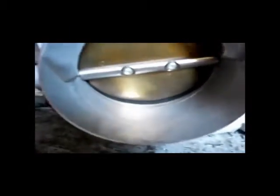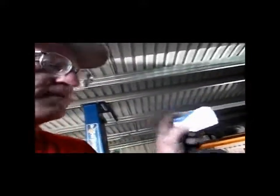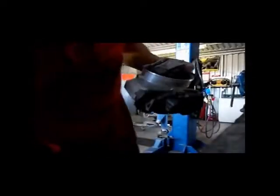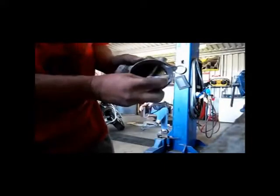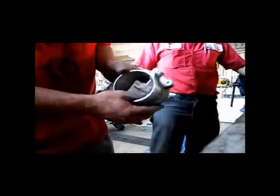So what we're going to do is slide that throttle plate closed, and we're going to wedge it somewhere like that, just where a little bit of the black line is showing, and that's where we're going to cut the groove. Now I'm going to set this down. Maybe you can see what I'm doing, but I've snagged a business card from my bank right here, and my business cards work good too, but I'm running out of those. So anyway, what we do is we take this and we simply place the business card in the upper section of this, and then we push it closed, and then we inspect it to see how close we are. So let's look.